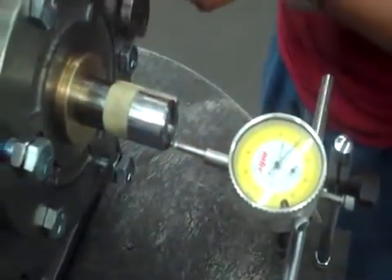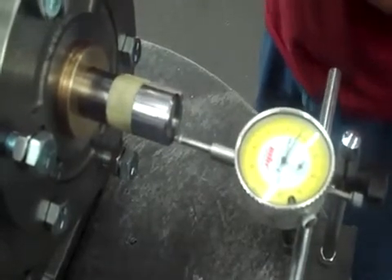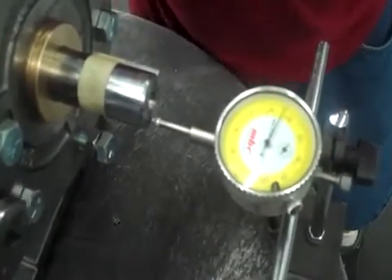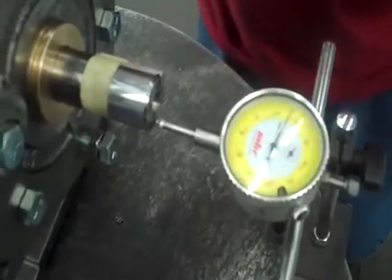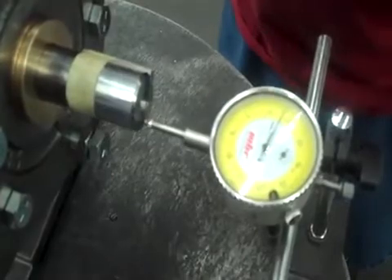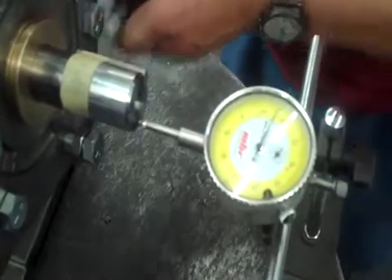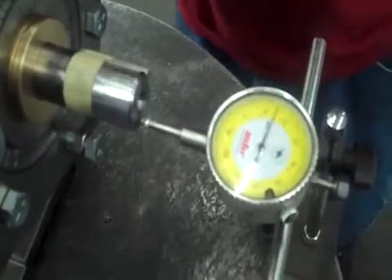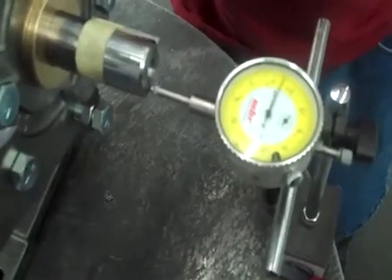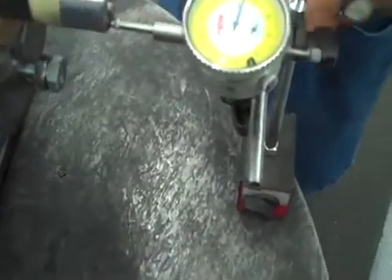The bolts being the way they are, it is going to move just a little bit. So I usually try to get it within a thousandth of 15 and then go back and tighten these just a little bit more, because the end of a bolt is not a real flat surface. Get those a little tighter, then go back again and get them to 15 thousandths. We are at 15 thousandths — that is our setting.